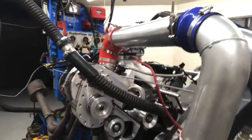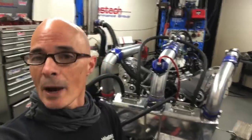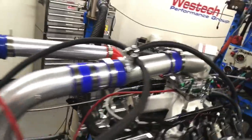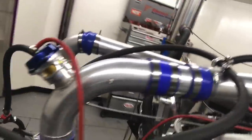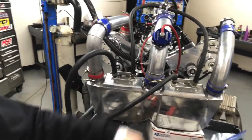Look at that - there's one Torxstorm, there's two. I also installed an air-to-water intercooler. Now a lot of guys are going to think: you're running E85, you don't need an intercooler; you're running a blow-through carburetor, you don't need an intercooler. And you're all right - but I did it anyway. I always like to run intercoolers on blower or turbo stuff. Also, I had two Torxstorms but only one inlet going into the carburetor bonnet. Running the intercooler actually solved that problem because this CX Racing intercooler was a dual inlet and single outlet, which worked out great.